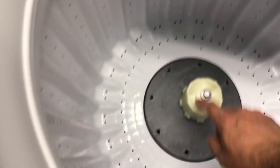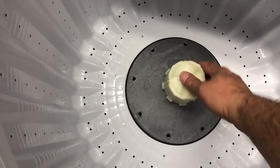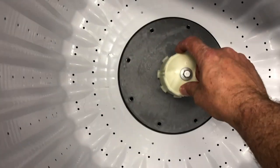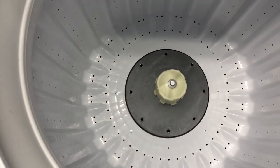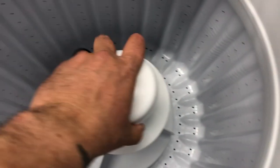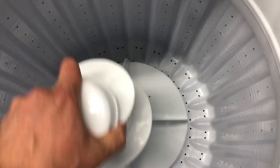Sorry about the finger, but this piece is actually replaceable. If you ever need to get them, you can get them off Amazon for like six bucks. When you have to put the agitator back in, it'll line up on these little grooves that you see, and you push straight down. You'll kind of twist it, feel where it doesn't want to turn, and then push straight down.